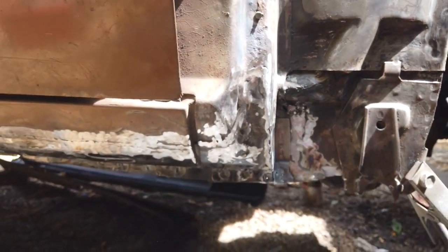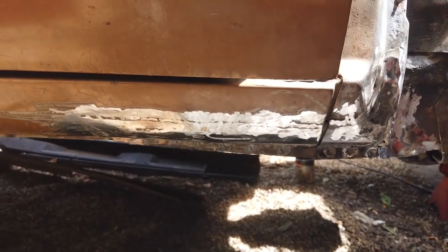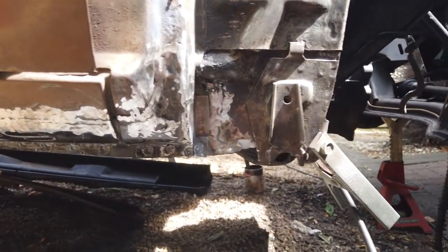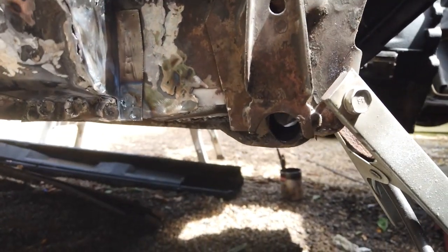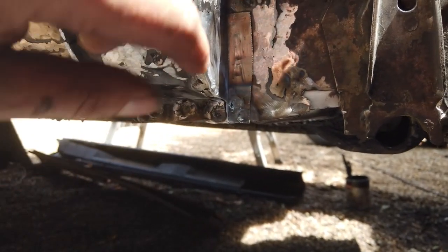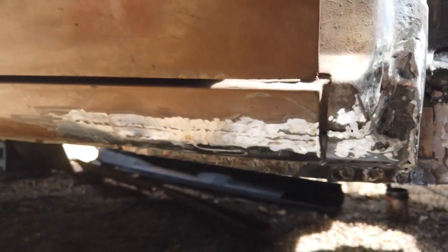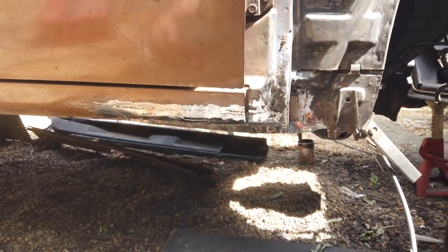So I'm going to put all the tools away, having an early break - going for something to eat, it's a nice afternoon, a bit of relaxation. We're pretty ahead here. That's going nicely - just needs a little bit of infill. I've just welded the corner in, trimmed the excess off, we've got that overhang tag lip that follows the lip, spot welded on at the bottom for the over-skin piece all the way along. We're done - pretty neat repair. Got to do the same on the other side now.